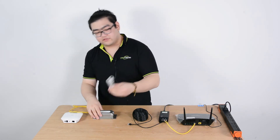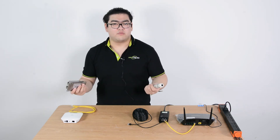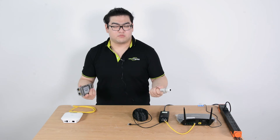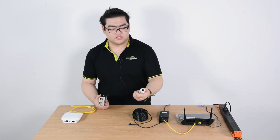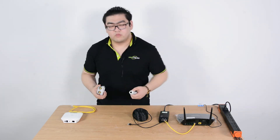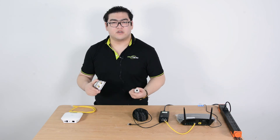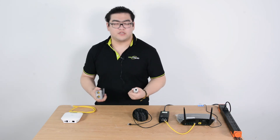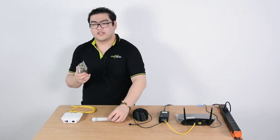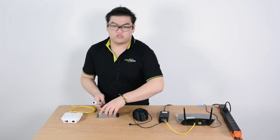So we choose between a one-input one-output and a one-input two-output extender. What's the difference? Not that much — the material is different, but they are both IP67 waterproof and good for direct burial. They both output 30 watts of power at the output port. The main difference is bandwidth: this one is up to 100 megabits per second, the other is up to 1000 megabits per second. If your home internet is 500 or 1000 Mbps, use the gigabit one. But most regular homes get 100 Mbps, so the standard one is good enough. The two-output model is handy if you want to extend to more devices.